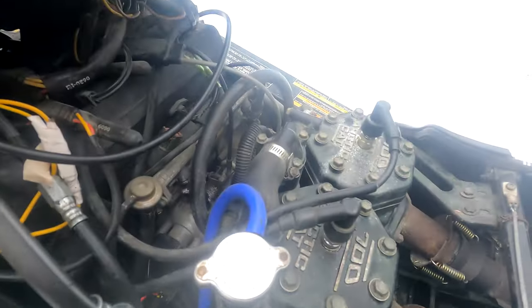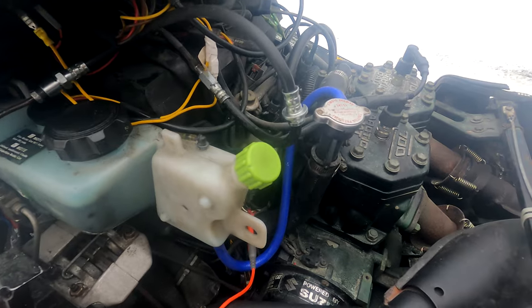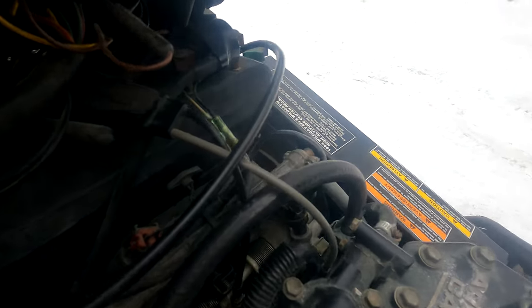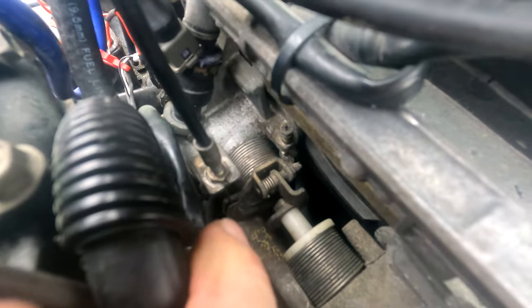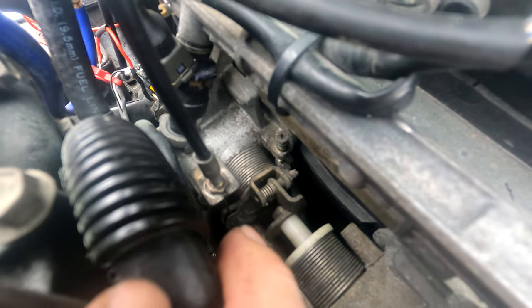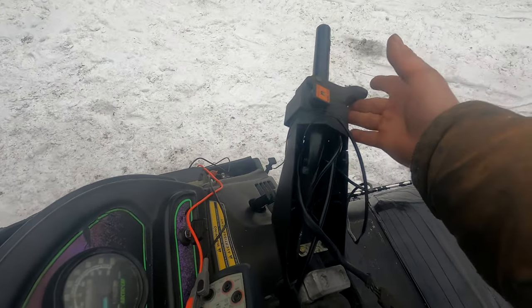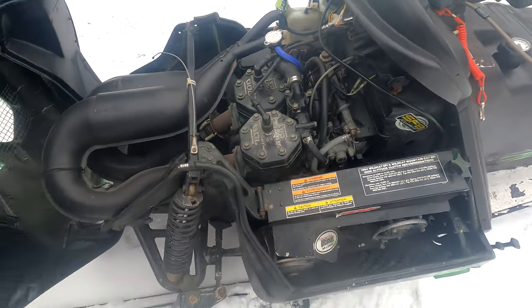Make sure you have relieved the pressure on the throttle screw. You've got a large band throttle screw — right there you see the little screw at the head. Back that right off so it's not touching. Also make sure that your throttle line is not jammed. Sometimes if you change the position of your throttle, it will actually pull on the line, which in turn pulls up on your throttle. Make sure there's all slack in that.